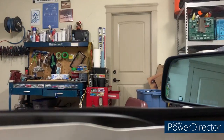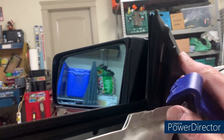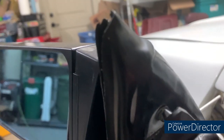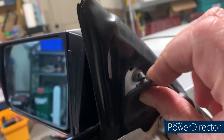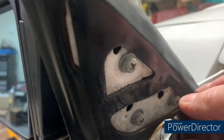I'm going to start on the mirror now. There's a piece of trim here that covers the fasteners — I've just started prying at it with a trim removal tool. There are three molded-in push pins in this trim piece. I've cut them loose — you can see all three of them there — and that should reveal the fasteners here, here, and then one more down here.